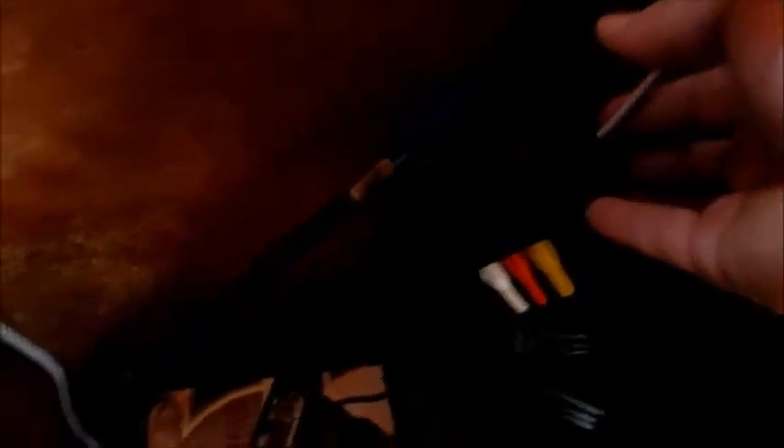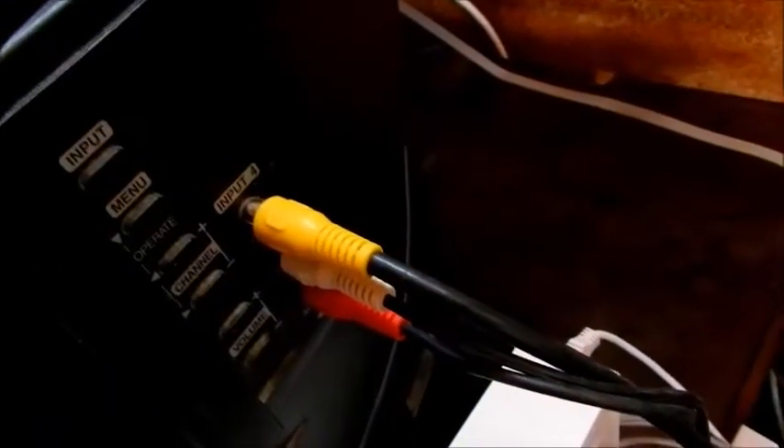Before I dig into it, I hooked up the plug that goes in the back to RCA out into Video 4 on my TV, and the TV is up and running. I went ahead and turned on the computer — you can see all the lights light up. Now to see if it actually comes out on the TV before I open this thing up and get to the video card. Right now nothing's happening on the TV. You heard the beep. There's activity on the hard drive, things are happening, but nothing coming out over here.